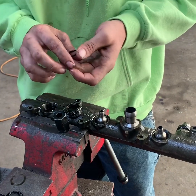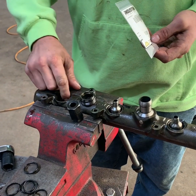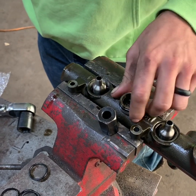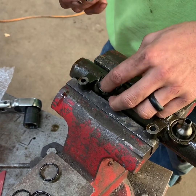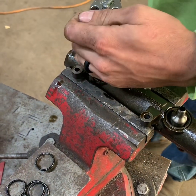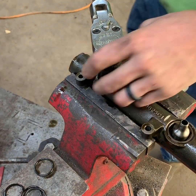Here's the old O-ring that came out from underneath where the cup goes. You want to make sure you get the new O-ring in here first and get it seated in the bottom all the way so it doesn't get pushed halfway under. Once it's seated, put the cup in and then the cap, making sure it's lined up centered. There isn't an actual torque spec I've found for these because Ford doesn't recommend replacing them — they want to sell you the whole rail. It's actually an aftermarket kit for the socket and O-rings. You just have a feel for how tight you got them out, and that's about as tight as you put them back. You just don't want it to leak, don't want it too loose, and I don't think you can get it too tight.